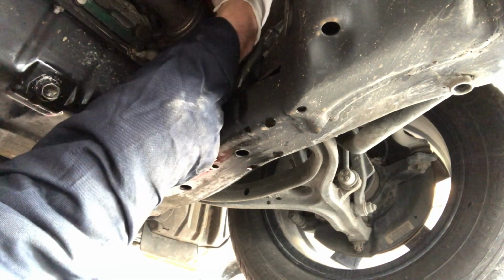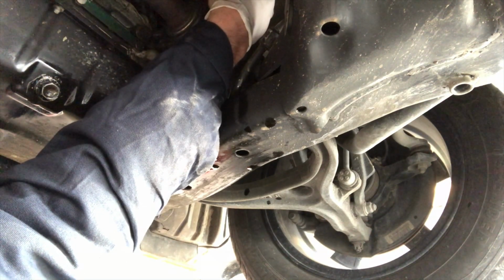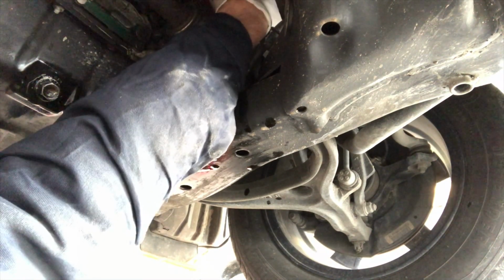And I'm just gonna put it on hand tight. Once I feel it just get snug, or it's just starting to create a seal, I'm gonna give it just one more quarter turn. You don't wanna go real tight on this, okay? Because you're gonna put it on there, just a nice little hand turn, and then what's gonna happen is it'll get like a suction onto there and create a better seal. So that's what you're looking for. So let's put some new oil in this thing.